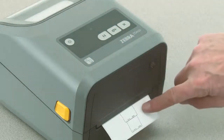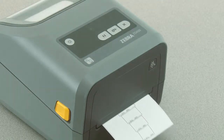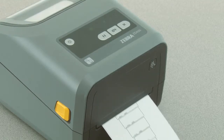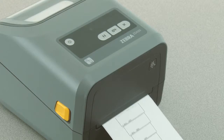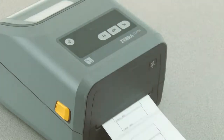The printer will print a 16 millimeter box and pause momentarily. The printer will then print a slightly larger box and again pause. When you see the printer print a box that matches the width of your media, press feed to set the print width.